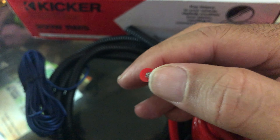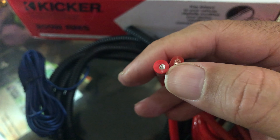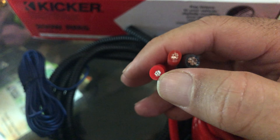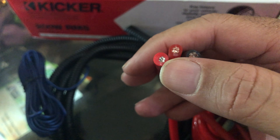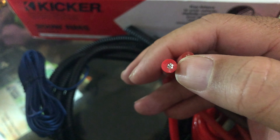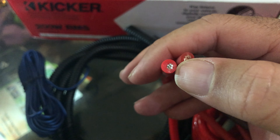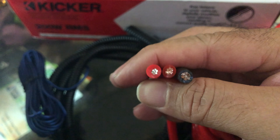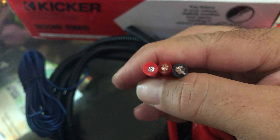Here's something to bear in mind. This cheap copper-coated aluminum is something you would normally get from companies like DS-18, Boss, and those cheap amp kits, and they say it's going to work fine — but it's not. This is not actually 8-gauge; it's closer to 12, somewhere between 10 and 12-gauge. This is the actual 10-gauge, and this is 8-gauge. You can actually see going left to right the increase in the core diameter going across.